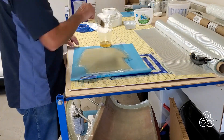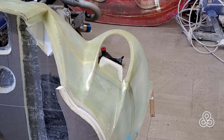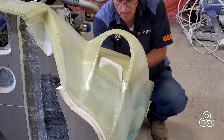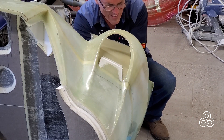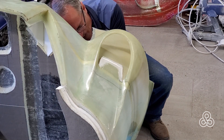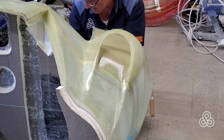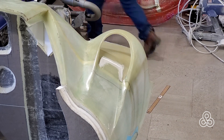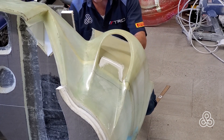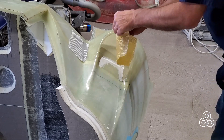We're getting pretty close to having all four layers laminated on there. I can bring the piece over — there's no epoxy on the back side of the foam so I can hang on to it there — and press it into place. Then it's a matter of taking all those little wooden peg struts and standing them back in the position they were cut for. I realized the weight of the wet resin was causing the back of that foam core with the fiberglass to sag down, so I grabbed a piece of foam, cut another prop rod, and jacked it up under there.